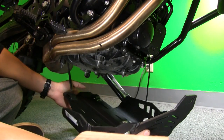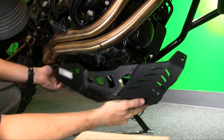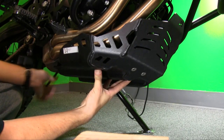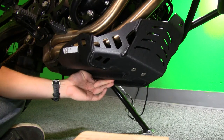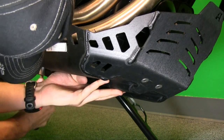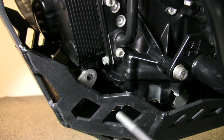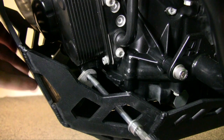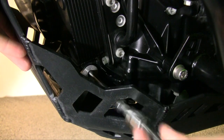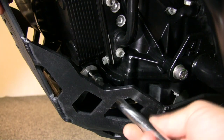Put the skid plate on the gummies by lining up the rear holes first, then the front ones, finally making sure the front mount bracket lines up properly. Hold the plate with one hand and, using the other, grab a 13 millimeter socket with a nut already in it and turn it a few turns to hold the plate in place. Do this with the remaining three nuts — a few turns on each is good for now. Insert the OEM through bolt with washer into the front mount position. You may need to move the bracket slightly to align everything properly — this is why we left it a little loose. Ensure the bolt is threading, and once the threads are started, go ahead and tighten this bolt down.